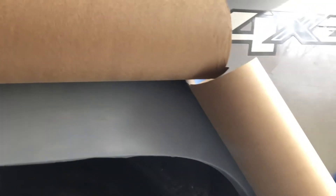So I wanted to show you this little trick that I saw on a video. Instead of just putting your paper or tape around the perimeter and having a really hard line that you have to buff out and sand out and whatnot, you put your paper like this, you tape it, and then you fold it over, and what that does is it allows it to naturally feather in the paint.